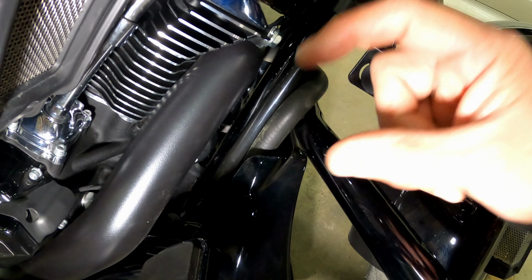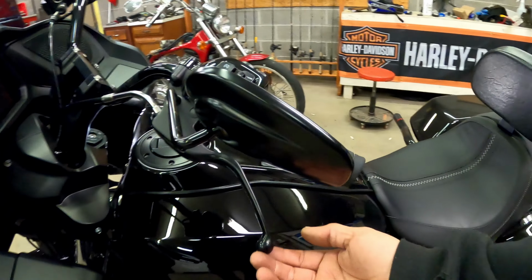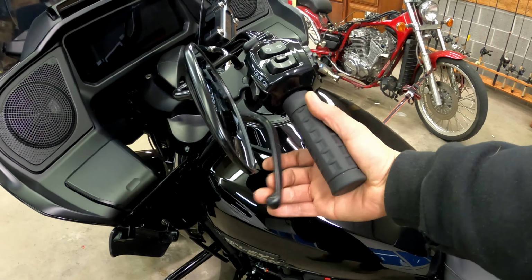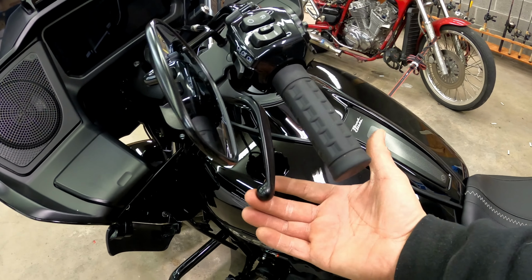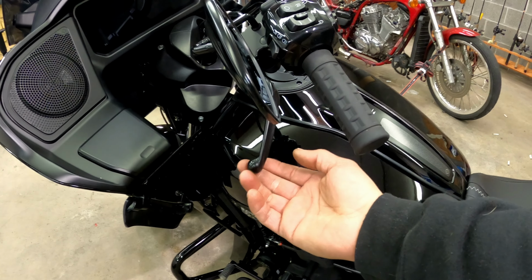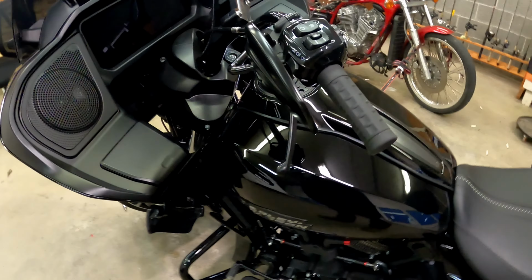and if you take this up and you see what I'm about to show you, it's probably going to be the same process. Now, I just want to be clear, this is not a clutch adjustment. We're just taking the slop out of the clutch lever itself. So you see how I got some slop? Well, a lot. I did this on purpose for dramatic effect. But even if you have a little bit, before it starts compressing those springs, we can get rid of that. We can make it so it's tight all the way from the beginning.